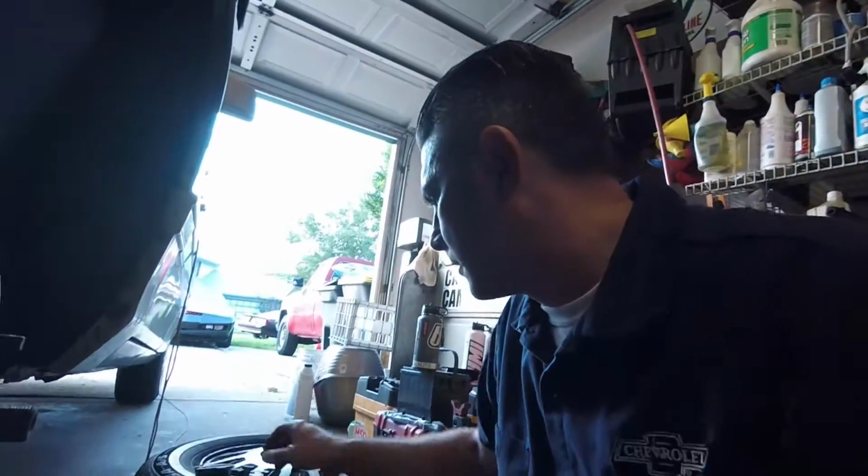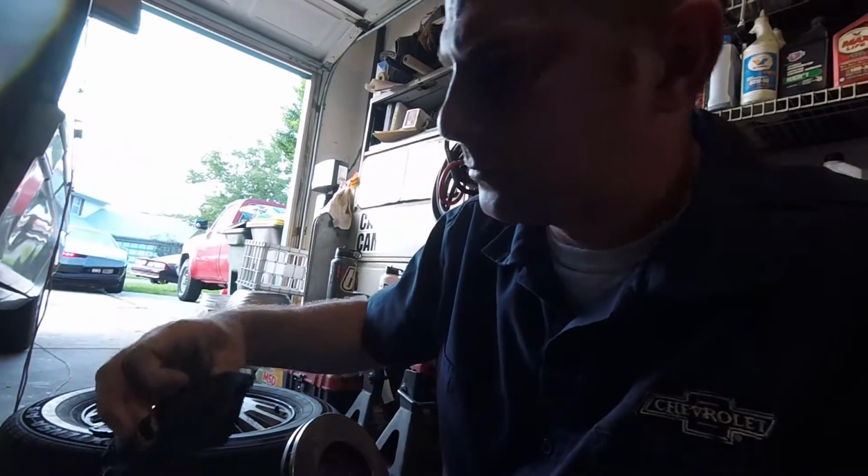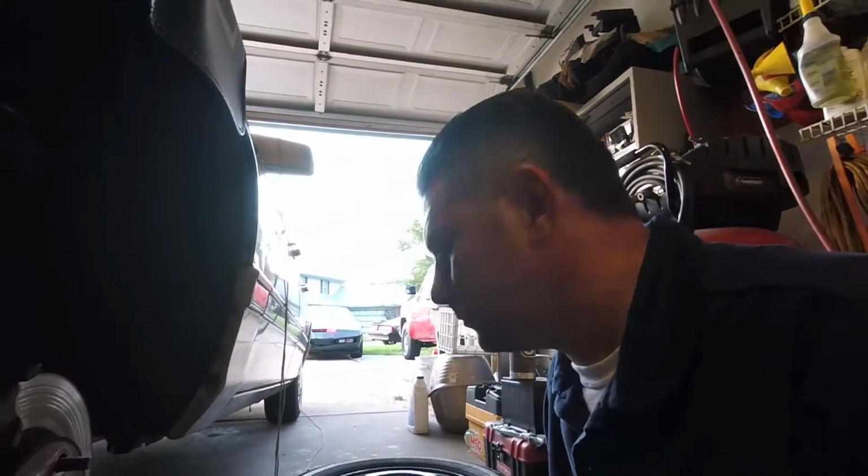Oh, goodness. Those are smooth, right? And these are big with these little hook-looking things right here. I think we're good to go. So I got brake pads as for what the VIN number says the brakes I should have on the car are. Alas, I've got a bigger set of brakes than normal. And that's not the first time I've had that happen with this car.